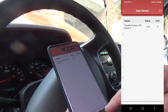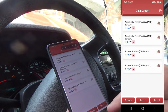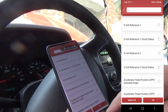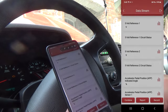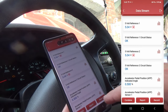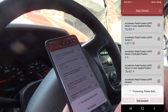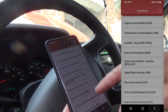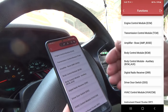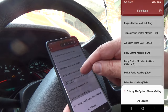If you just want to see a graph individually, hit the little graph icons. You can also record all the information — there's the record button in the lower corner. Now let's go into the body control module, which generally has a lot of special functions and active tests.